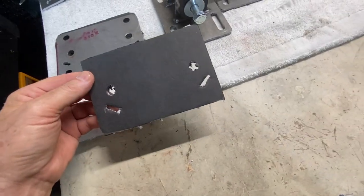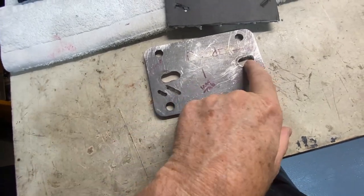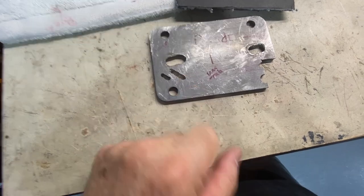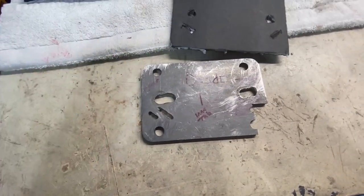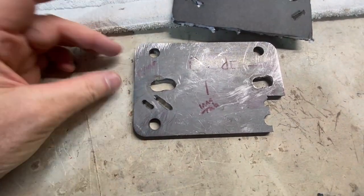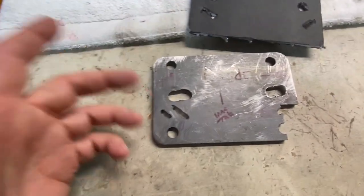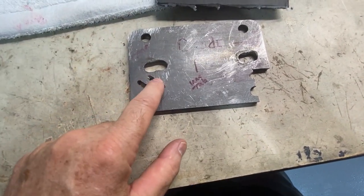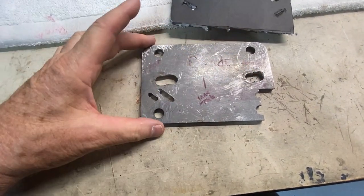This is what I'd refer to as version 1.0. In drilling the plates, I could see I needed to elongate the holes — I had to do it with the drill press, which created a different slot position. That's when I realized we needed to do something different because of these little tabs. So version 2.0 is what's in the truck right now. They're a slightly smaller plate, made to my specifications from a diagram I drew up, cut by a machine. We did away with extra holes since we're cutting the tabs off the frame. We'll just have two elongated slots for the bolts to slide through.